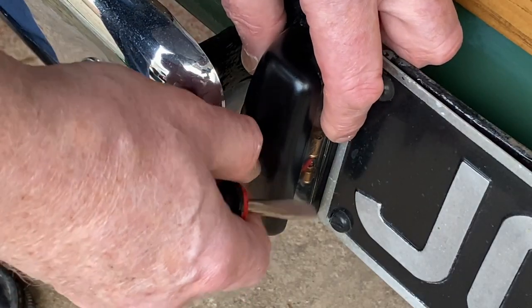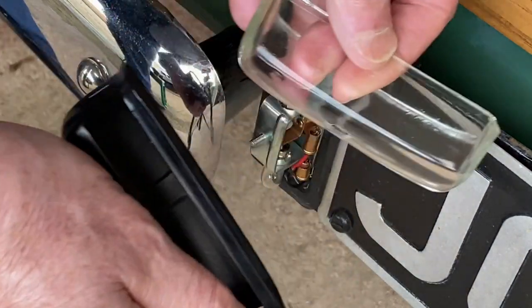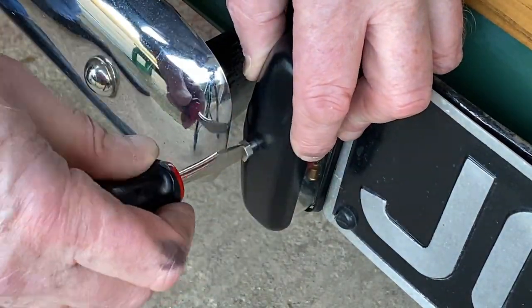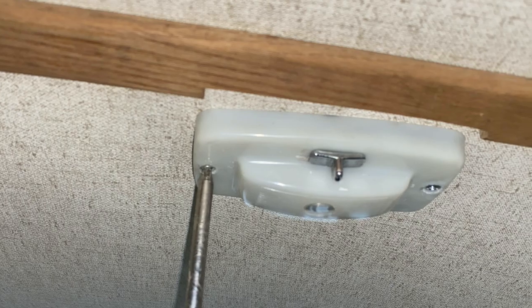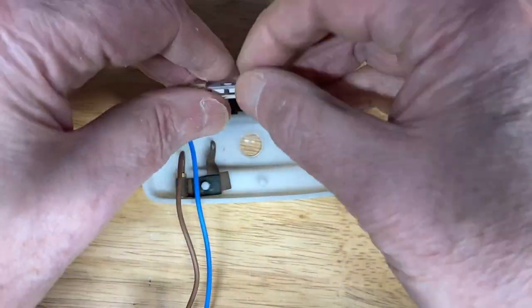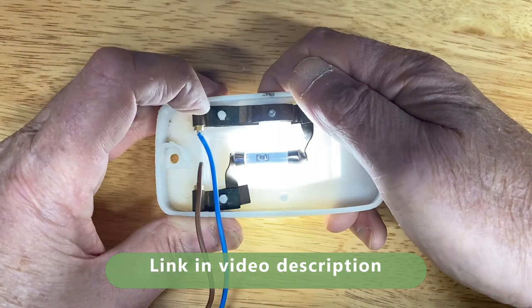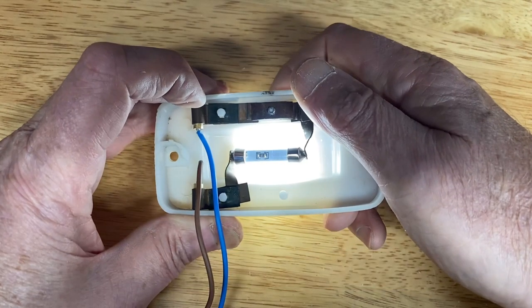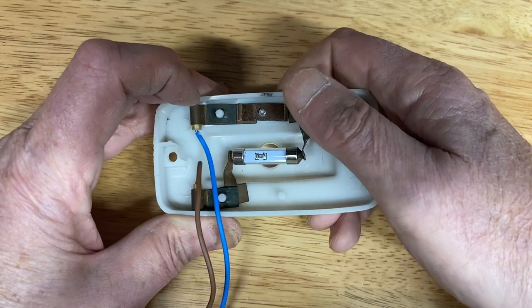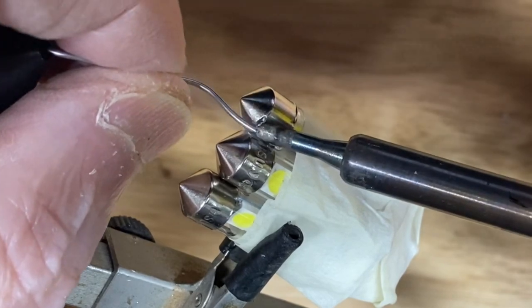The number plate lights are pretty easy — just remember you'll need four bulbs and don't drop the glass part. The interior light is held in place with two screws. The bulb is reversible so you don't need to worry about negative and positive earth; if it doesn't come on, just reverse the LED. Remember it only has light elements on one side, so these need to face the right way. The LED bulbs generate very little heat, so I'm going to put three in here, soldered together.